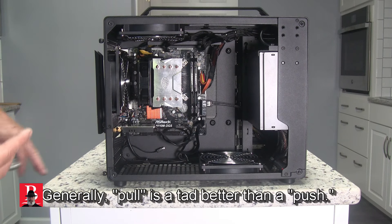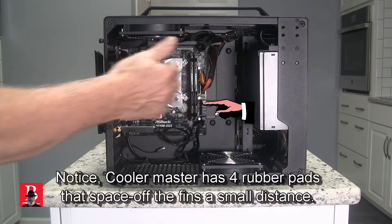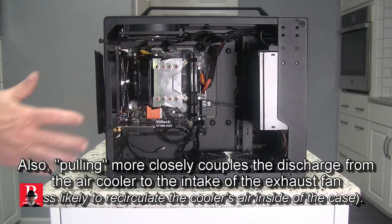The air conditioner is running — we'll just live with it. We left all three fans in their spots. These two are wired together off one PWM so intake and exhaust are balanced. This fan and this one are also wired together, so as the cooler pushes harder we pull harder going out of the case. Moving from this side to this side, we'll get a little less short-circuited airflow and pull it straight through — which should be more efficient, with less self-heating inside the case.